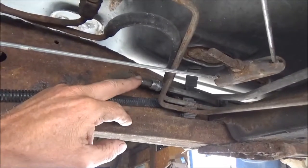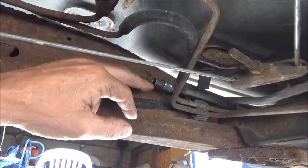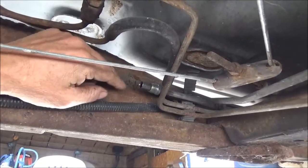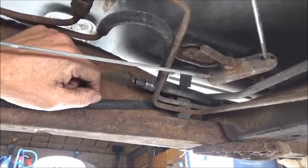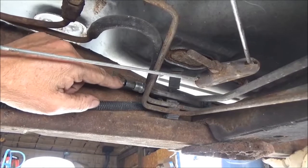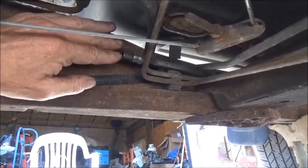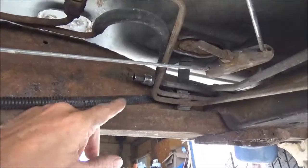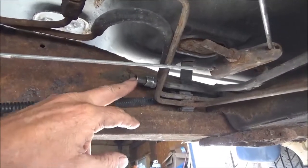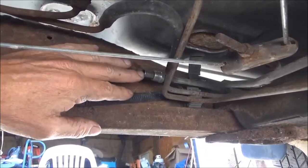Well, on brake lines you're supposed to. I don't. I will if I need to, but on my own stuff and on old junk that somebody may have, I don't mess with flaring the fittings, because I can put compression fittings on and I can put them on right and they will not leak. But if you don't put them on right, then they might leak, or they might actually blow apart. But if you put them on right, that'll never happen.